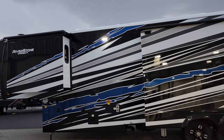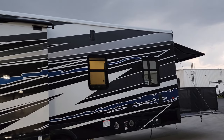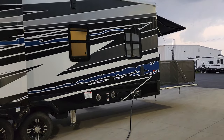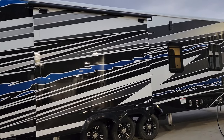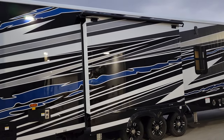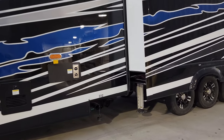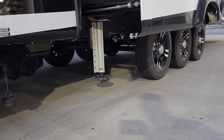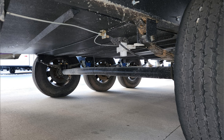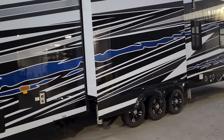There's a little overhead security light in case you need to come over here at night. Also on the back, I forgot to mention there are two vents — one up high and one down low — designed to allow fumes to escape when traveling if your toy has gasoline in it. Up here we have the dump area along with the spare tire. Just in front of the rear axle is the fresh water tank drain — inch and a half drain valve so it drains faster than the three-eighths versions on most RVs.